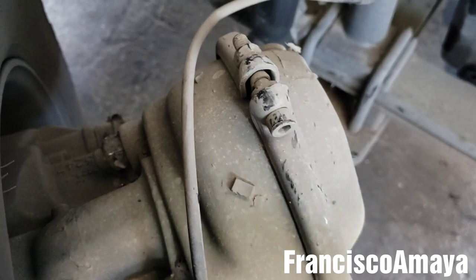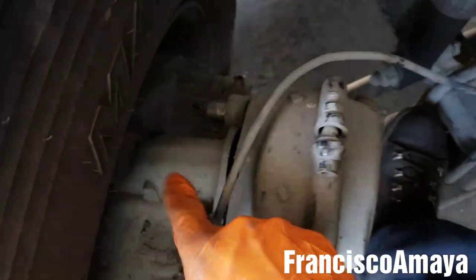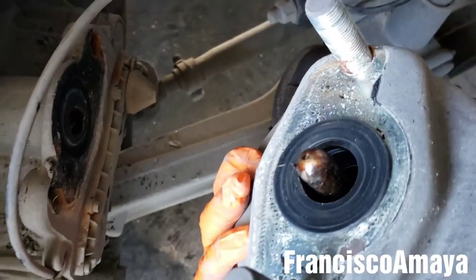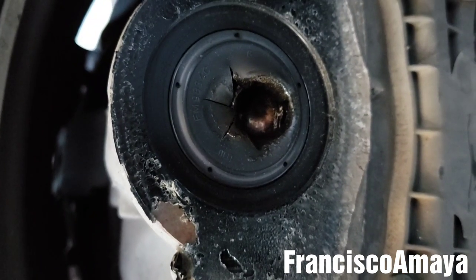So that's how you do it if you have the other type of brake chamber — in this case this is a T20 — but that's how you wanna do that. So continuing on this one until I get it out. The nuts are removed, the two nuts — here I have them, they're fine thread, so it will take a while to remove them. Now it's easy to remove the brake chamber — you just hold it and remove it like this. There is no pressure going on. We have the rod right there, and we have the orifice that goes right there. That's where the rod goes, it pushes the brake pads, and adjusts the whole thing because of the adjuster right there, and the whole mechanism works.